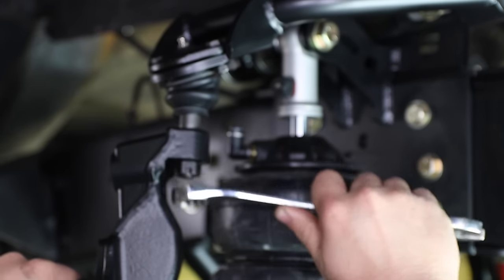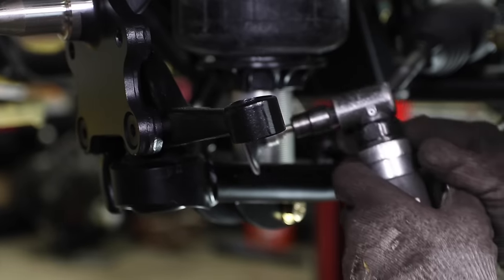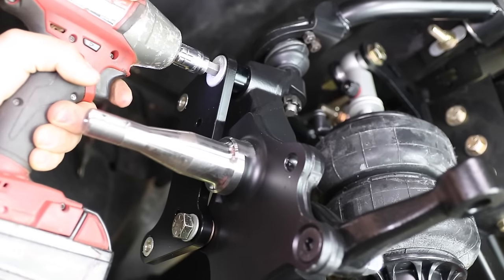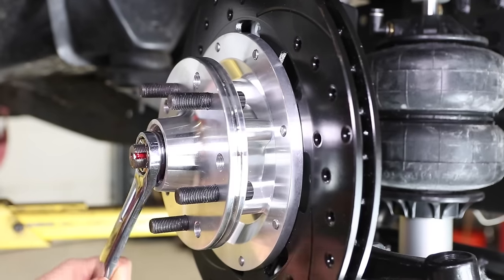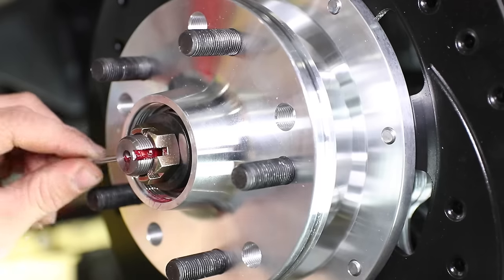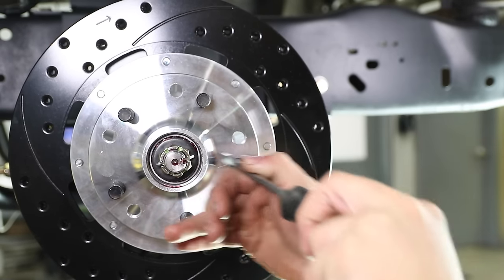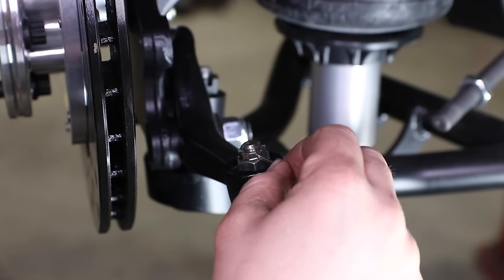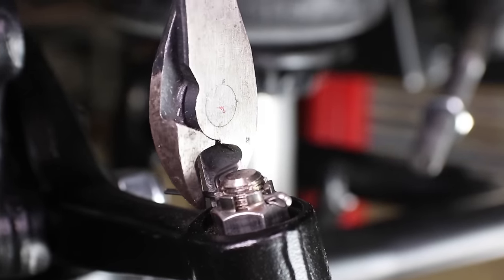Even more importantly, we made our front system with a 63.5 track width, so you can use traditional offset wheels to keep those classic truck looks. When compared to other salvage yard options or street rod sourced front suspension systems, the Ridetech system is significantly more structurally sound and provides uncompromised suspension geometry for vastly superior ride and handling, and the simplicity of keeping your factory frame.